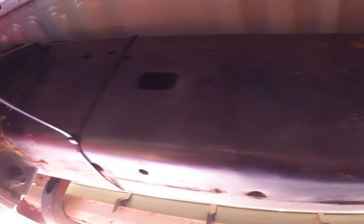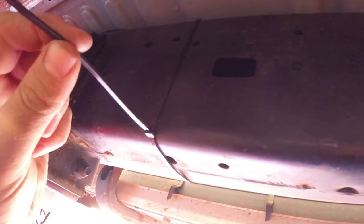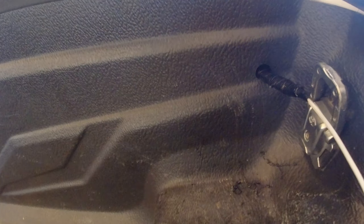I would normally find a fuel rail or an existing wiring loom to cable tie every 30 centimetres along under the chassis. But on this side of the Hilux on the right-hand side, there's nothing to cable tie against, so try to find some extra-long cable ties and go the entire length around the chassis, hiding the wiring at the top as you go. In the tub, I drilled a 19mm hole with a hole saw through the tub liner and straight through the tub, fed through a draw wire, tied that to my wires, and pulled it straight through.